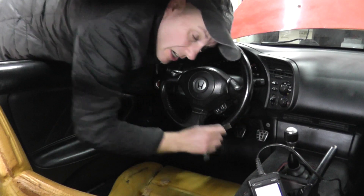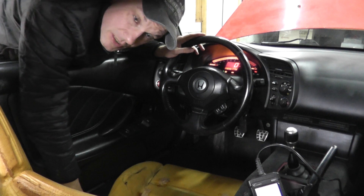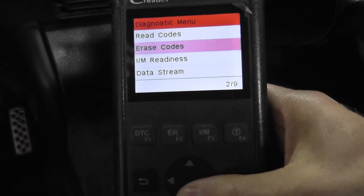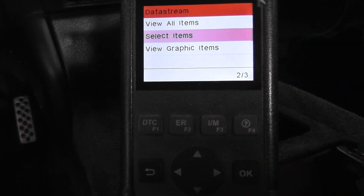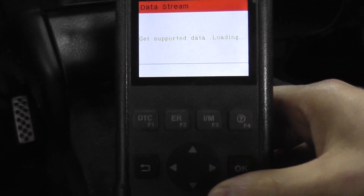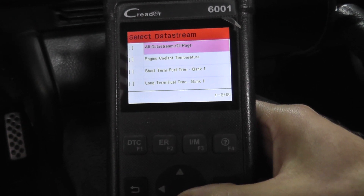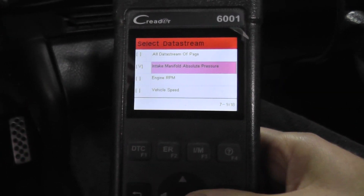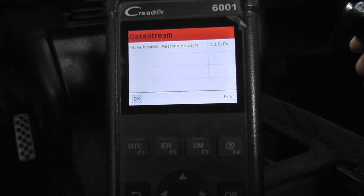All I'm doing is taking the ignition key and turning it to the on position — no need to crank or start the car, not yet at least. Just turn it to the on position. Ultimately we're just getting a reading specifically from the MAP sensor, and we need data stream to do that. You can do this without a scan tool — I showed that many years ago on a Nissan Maxima and I'll include a link in the description box below. But this is just a very big time saver. Find the MAP sensor — intake manifold absolute pressure — choose that, and we see a reading of 100 kilopascals. That's a good reading. I don't have a trouble code for the MAP sensor; I'm just doing this as a how-to.